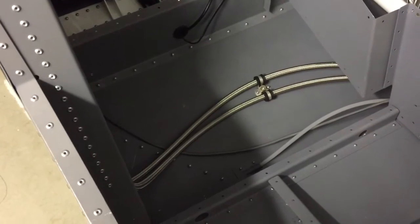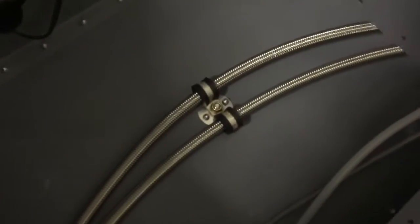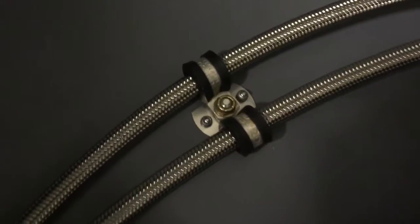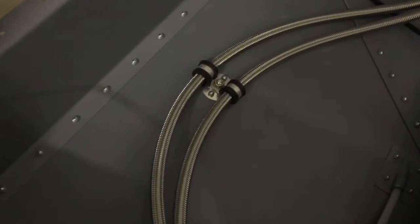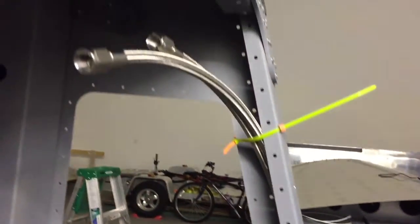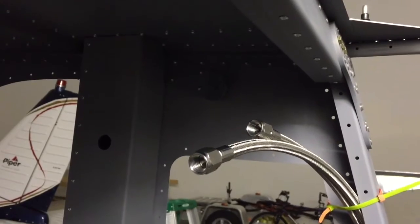I'm going to include one more clip with this video. These are how the lines are secured in the back of the fuselage. I have these little standoffs here, one on each side. You can see they just go from here up into this channel, and then they're going to come out right up here and go into some elbows that will go into the wing. That is the complete routing all the way from the fuel selector valve through the center — they split off to go this way and up, and that way and up.